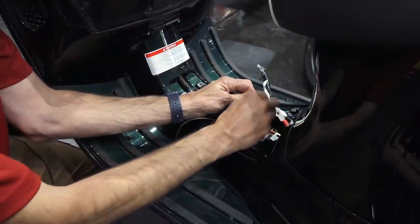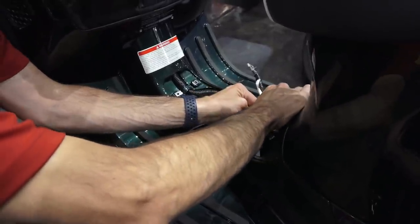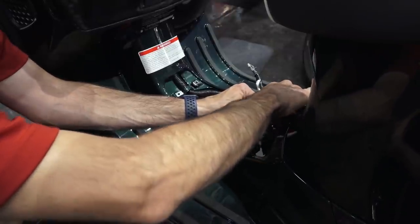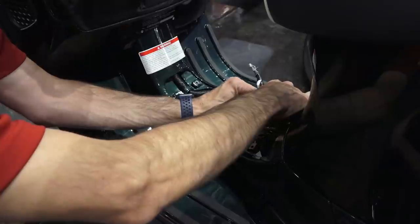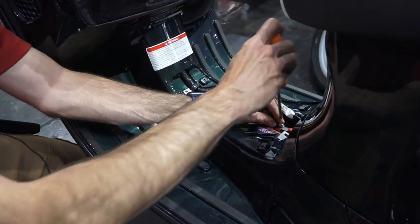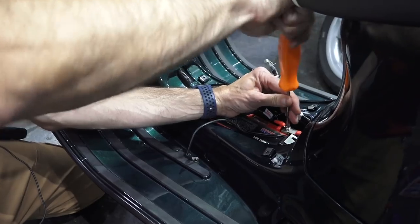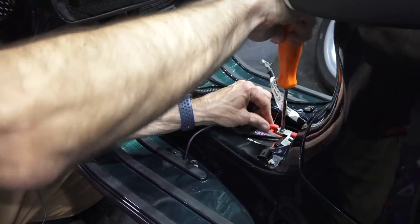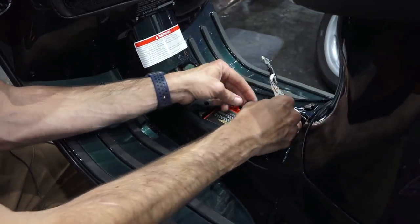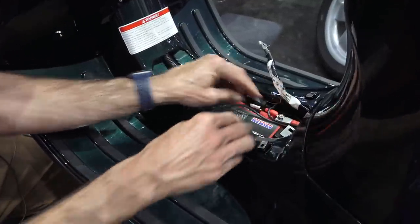With the battery tender lead, put the ring terminal of the battery tender first, then the much larger terminal of the scooter second — you'll get a better connection for the cranking amps. Go ahead and take your Phillips screwdriver and tighten that down, making sure it's rather tight. You can tuck this fuse holder right between the battery. Then your negative just goes on to the negative post.